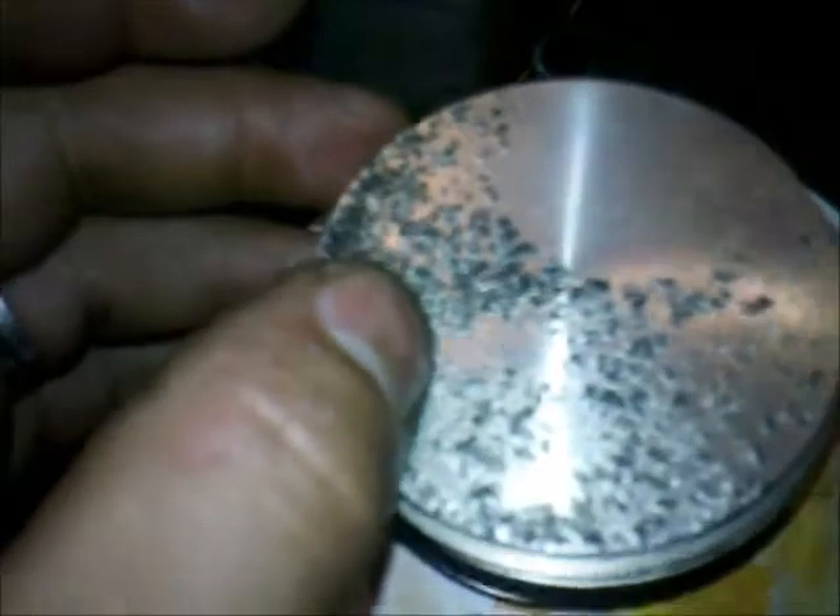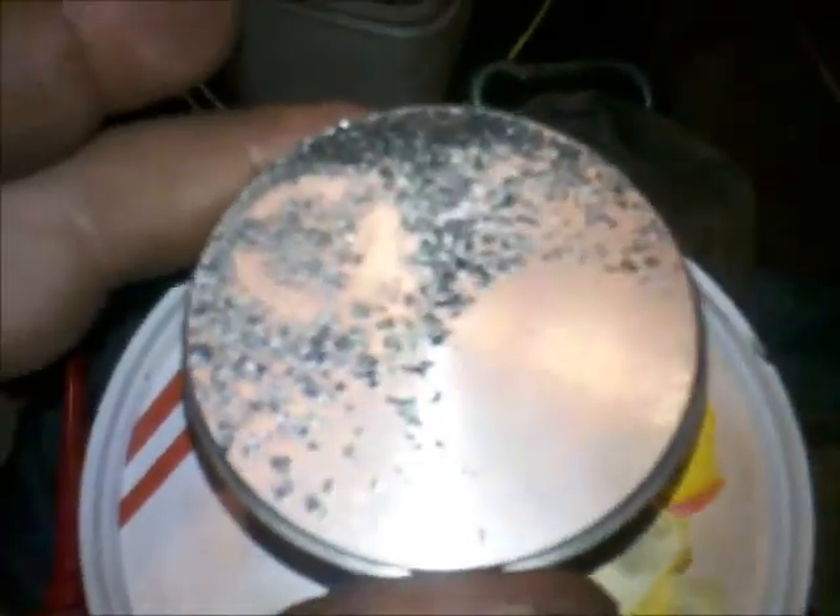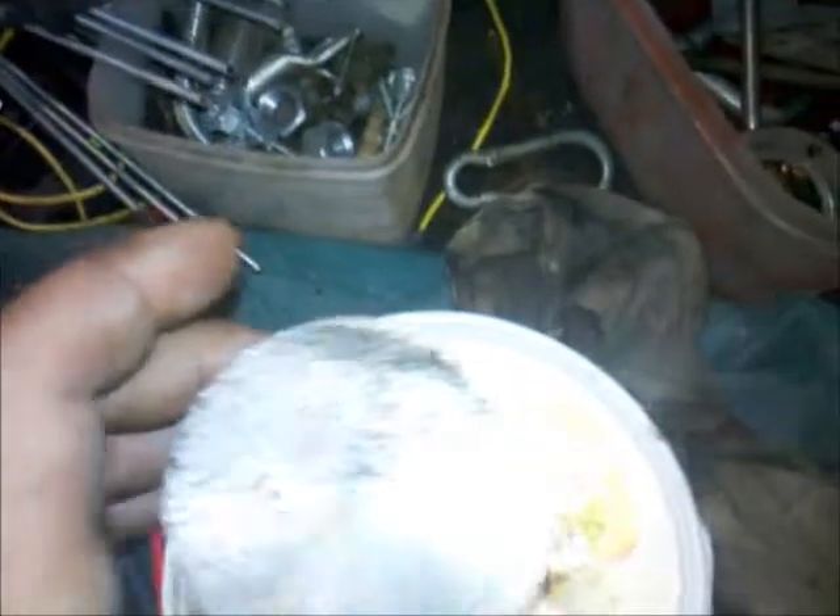The piston itself — the inner side — is okay, but on the top side I've got some pitting. There was some debris inside and thousands of little dots were made, but I cannot imagine that this pitting caused the camshaft problem.